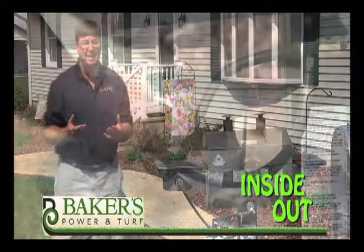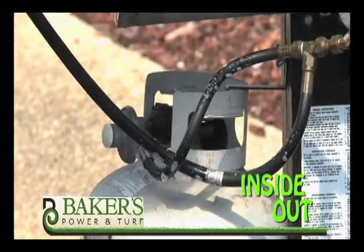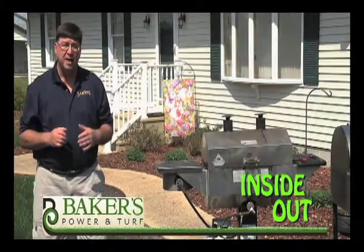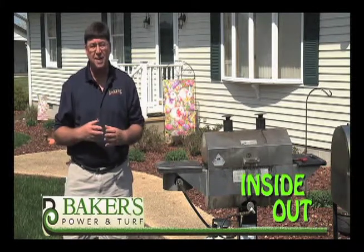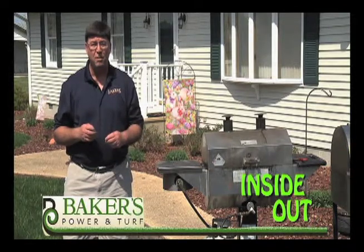Checking for leaks is real easy. A little bit of soapy water in a spray bottle, spray all the connections, spray your hose to make sure before we get going, we have no leaks at all with propane. And don't forget, the new tanks that have the OPD valves, once they're disconnected, if we lose the propane in the lines, it's a little tricky to get those lines filled back in and get them working properly.